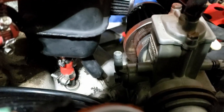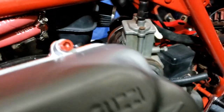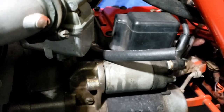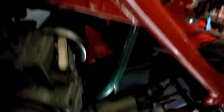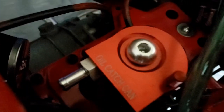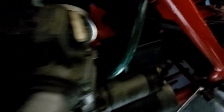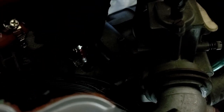Oil line wise, that just leaves that one there which is going to be fun for sure, and then this one here which also drained onto the road. This overflow is the one we were going to put into our oil catch can wherever that ends up being. I'm wondering if we can do the same with that one — maybe some kind of Y joint. This one is 8mm inside diameter, this one is 14mm outside diameter, and that's probably about 10mm, so we've got all kinds of stuff to marry up.